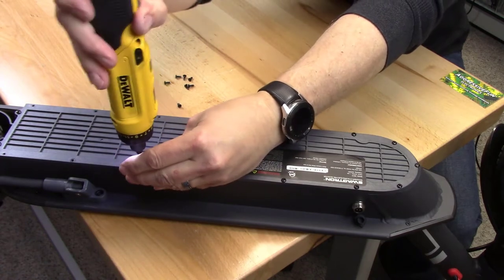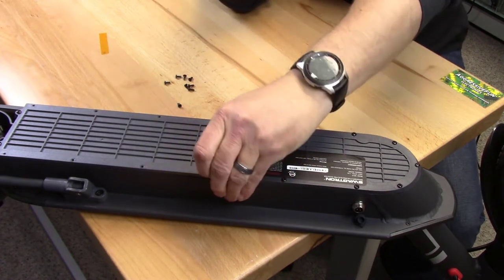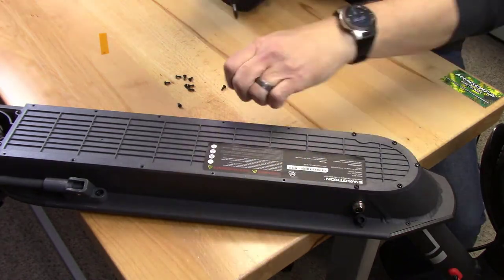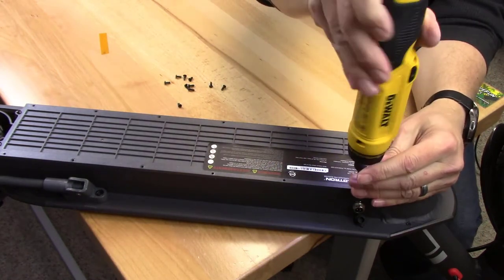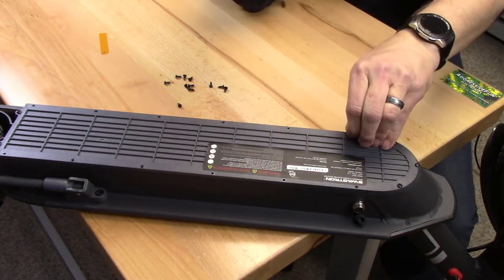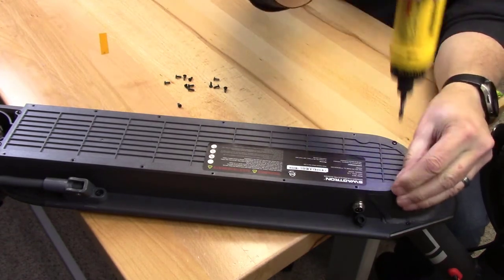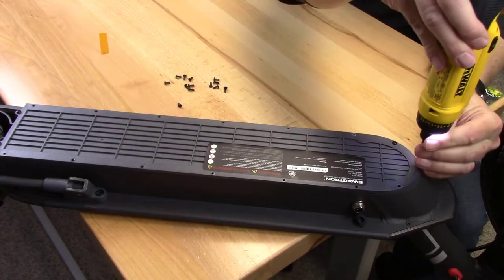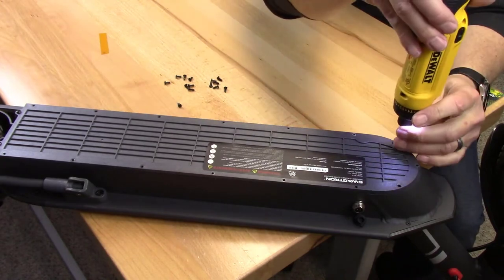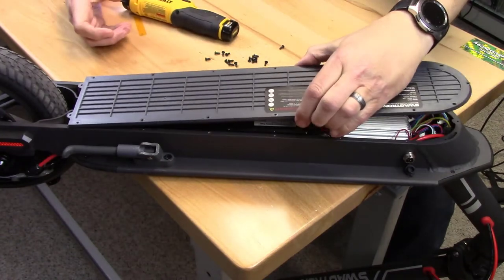So it's not going to turn on a motor. It's not going to show the display. It's not going to have any of that kind of features powered up. But that controller board is still going to be powered up. So my theory right now is, and my task right now is, we want to disconnect the battery. We want to disconnect all of the power from the electronics and see if a hard reset, power down, power back on of all of the electronics sets the processor back to normal.